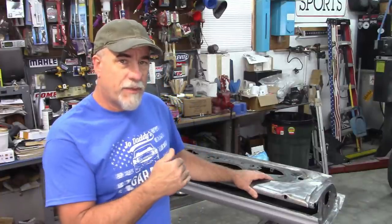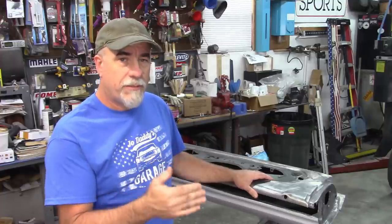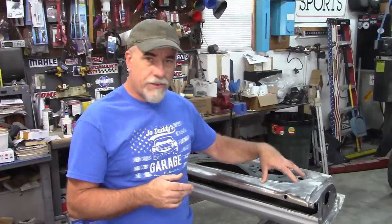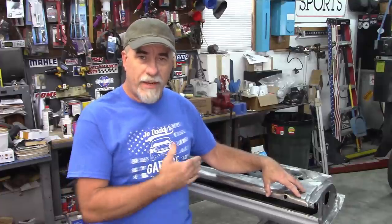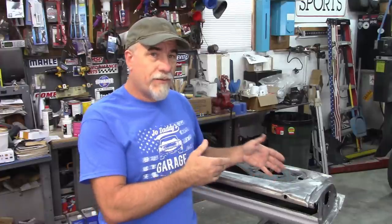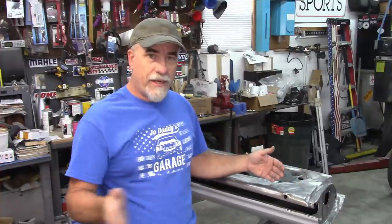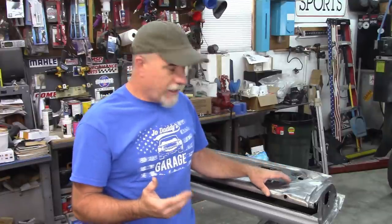And normally I've been spraying black on the rest of the car before I go to any other build. But in this case, I'm going to spray with gray. The reason for that is I'm going to top coat the inside of the door with black. I want to paint this black. By using black epoxy, I can't really see the spray pattern or anything with the top coat. If I use the gray, well then I can see how much paint I'm putting on in the process. And hopefully I can come up with a good solution.